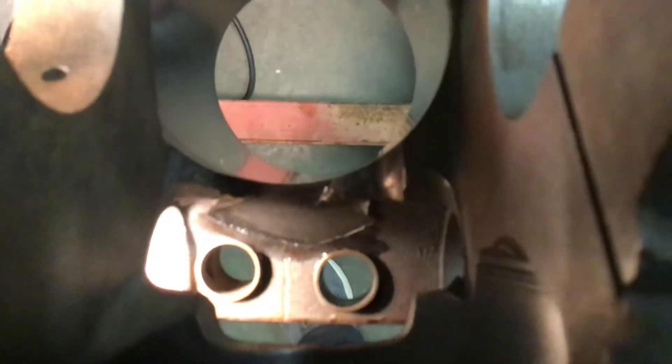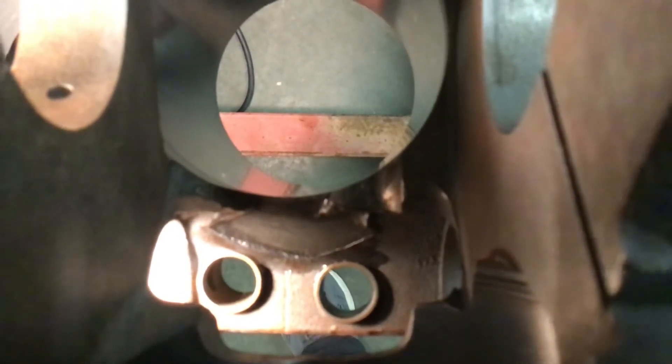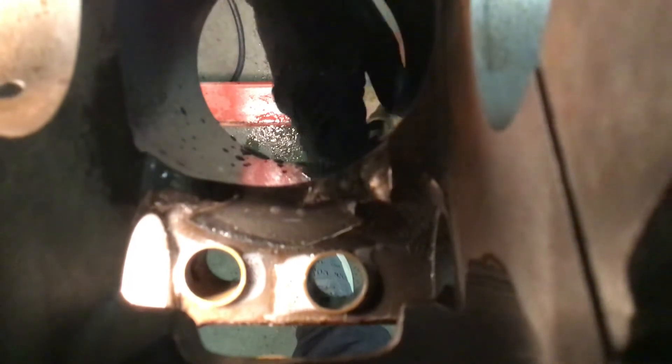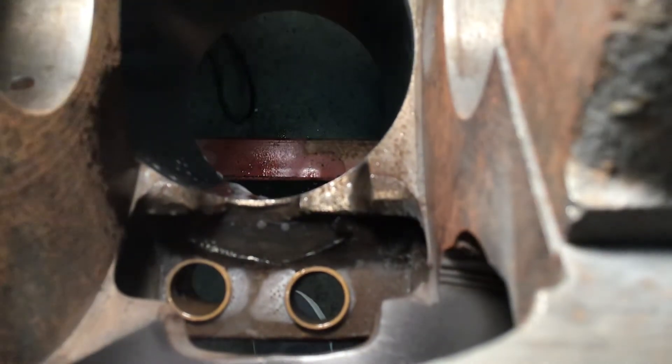You can paint over it if you want, but there's no reason to here since all that area will have is oil. Let me go ahead and do a pressure test so you can see it yourself. All you do is get soap and water, apply some air to it, and you'll see — as you can see, there are no bubbles, nothing pushing out of it. It is completely sealed up.